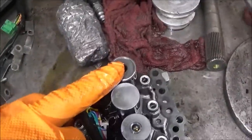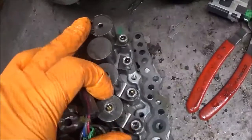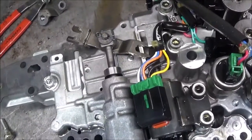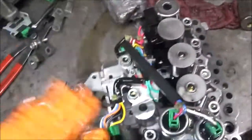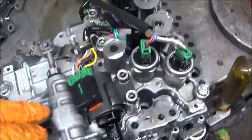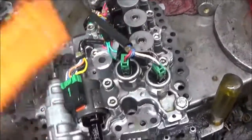This one has two pressure switches on it; this one has only one pressure switch. By having two pressure switches, it has three extra wires on here, and this one has no extra wires. Also, this solenoid here is shaped differently from this one. The wire colors are different, and these over here for the ratio control motor — I don't know if the color of the wires means anything, but if it's missing three wires, something is definitely different. This valve body is different from the one that came out of his original transmission.